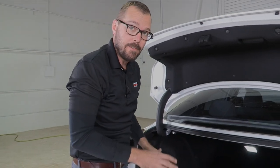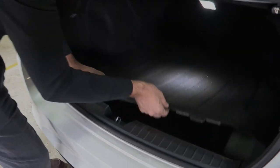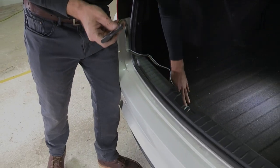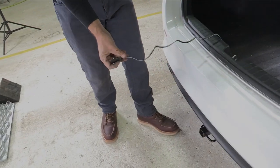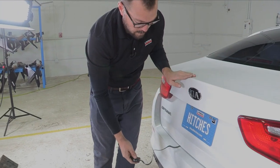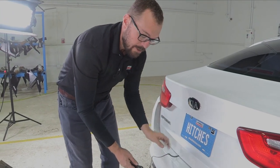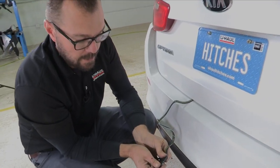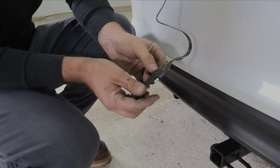Now that completes the installation of the wiring to vehicle kit, and we're going to keep it stowed in our spare tire well. When we're ready to tow a trailer, we'll simply lift our floor mat, bring our wiring out, and close the trunk on it. There's weatherstrip in there to keep the wiring protected. Remove the dust cover and this is where we'll make our trailer connections.